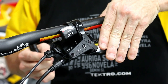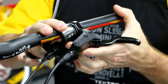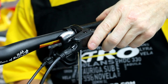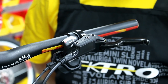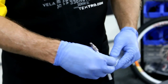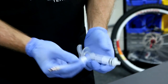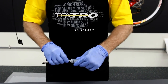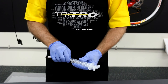Preparation for bleeding is important: adjust the lever so the reservoir tank is level to the ground and the bike. This is necessary to remove the bleed port without oil spillage. Connect the injector to the adapter, slide the piece over, connect the hose, and tighten down.